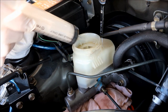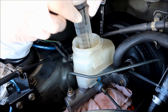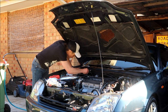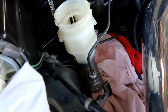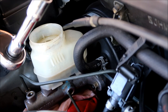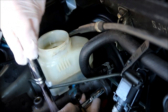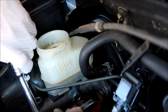Do not get any brake fluid on your paintwork — if you do, wash it off immediately, because otherwise your paint will come off. A little bit of penetrating oil should do some wonders; it's quite hard to get off otherwise. To get this one off, we do not use a ring spanner — we're going to use a 12mm socket with a ratchet extension. As frustrating as it can be working in such a small area like this, you don't want any setbacks.